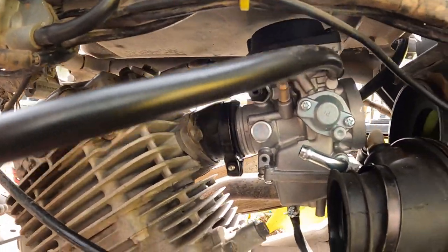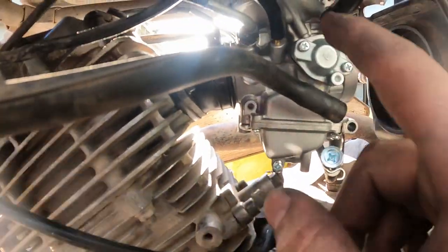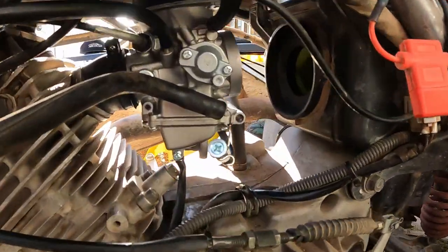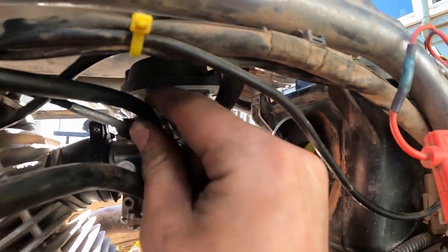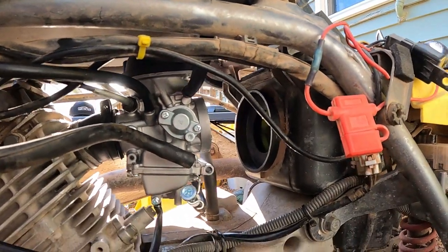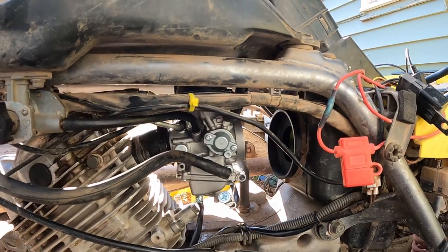After a little bit of fighting we got that in there. Now we're going to put this o-ring with the small end down towards the bottom, just set that in there, then set the cover on top and put the new screws in. Now I've got the new carburetor wiggled inside. I'm ready to connect it here, put this guy back, connect all the other hoses again. Fuel line hooked up, other fuel line hooked up. This little line — I'm not sure if it's choke or throttle related — is hooked up. The airline is hooked up, although I have to buy a new fitting because ours doesn't fit the back side. But you'll be able to put yours on, put the clamps on, and fire your beauty back up after you put those plastics on.